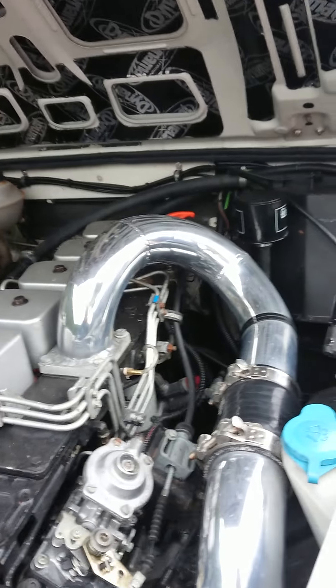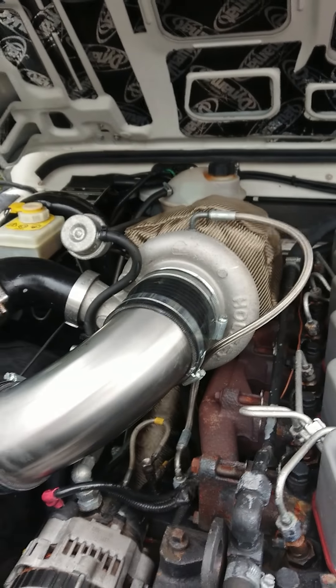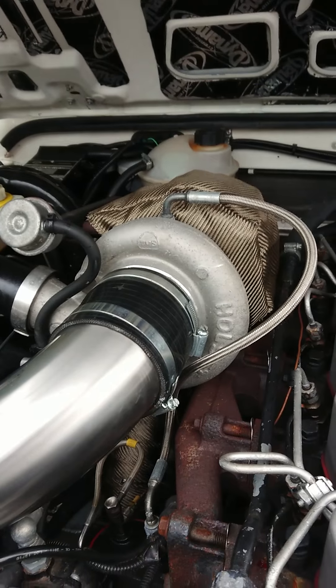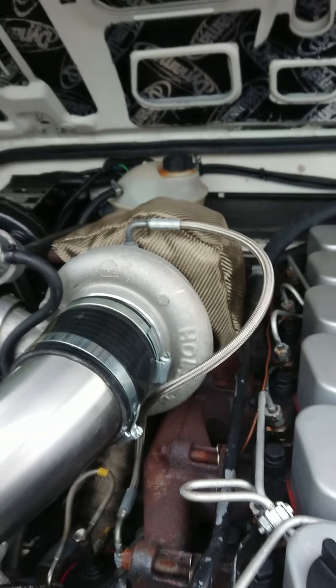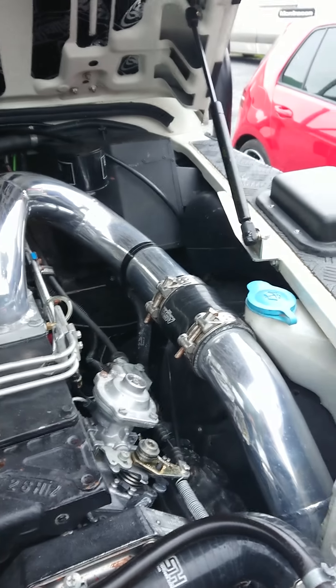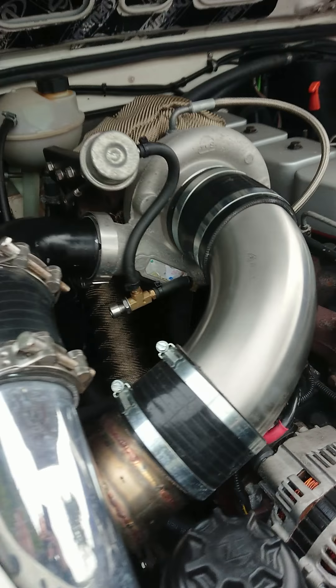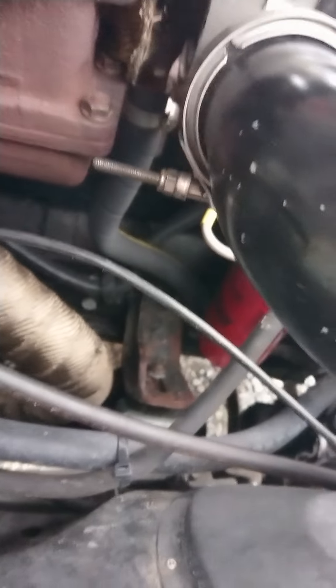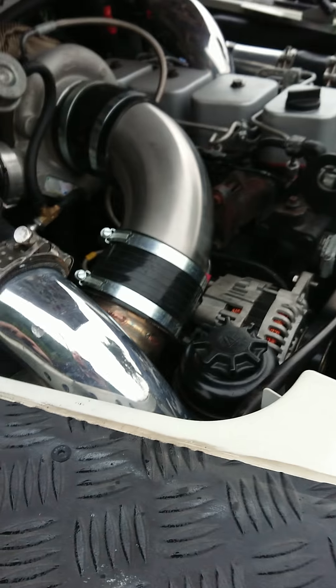I haven't really had any problems with that. The turbo is an HX35W that's off a 210 P-Pumped 6BT or off a C-Series 8.3. To put it in the Land Rover there wasn't much cutting. Rhys does an adapter kit with some engine mounts — they probably need a coat of paint on them. Basically mounting it in is straightforward.